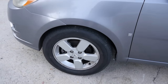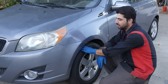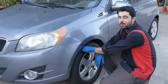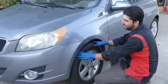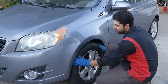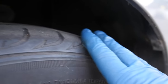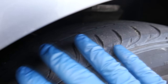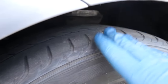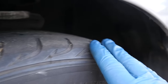As far as how you can tell whether you have bad shocks or struts, let's start with a good visual inspection of the tires. You could have uneven wear on your tires if you have bad shocks or struts, though a lot of times that's due to a different failed component. However, one good telltale sign is that if you run your hand on your tire, especially around the edges, you will feel your fingers catching every tread on the tire. If that's what you feel, it's due to a shock or strut that's failing, allowing for excessive bouncing and movement of your suspension system, deforming your tires especially around the edges.